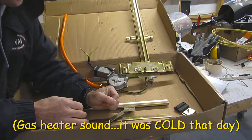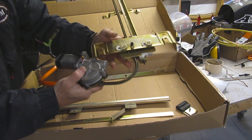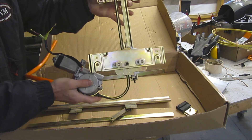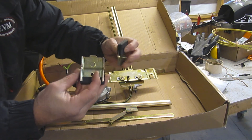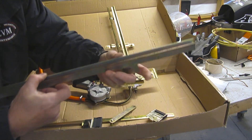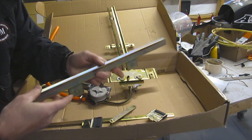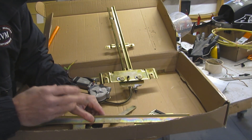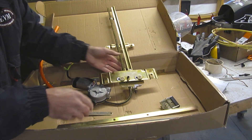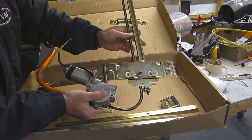Time to put the window regulator in. This is what comes with the kit: it's got the motor, a flexible tube for a flexible shaft that runs up through the channel, and a couple of mounting brackets. There are two different ways to mount the glass — you can use these two rubber-clad brackets that mount here, or this channel here, where you would squeeze in the mounting tape for the glass. I haven't decided yet which one I'm going to use. There are also a couple of metal bracket pieces for mounting to the door. Let's take a look and see how this fits in.